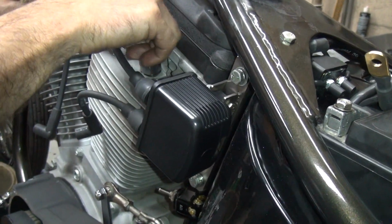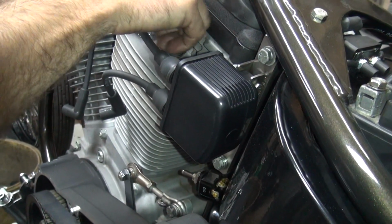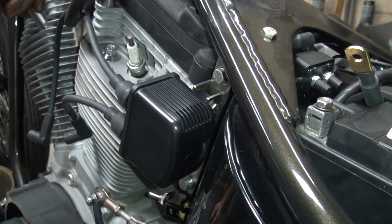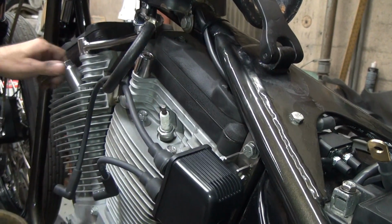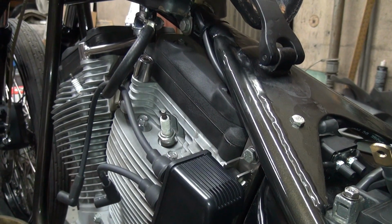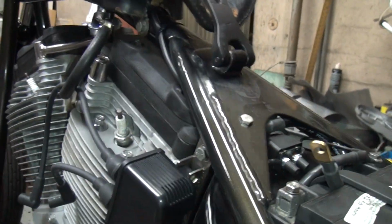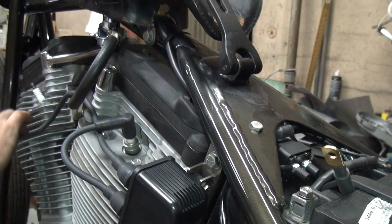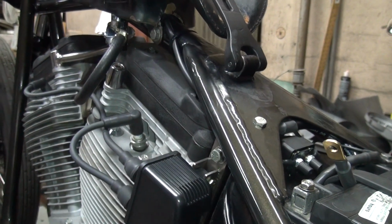How long is that belt going to last? Would a belt last, being that narrow? I've seen them come out like that before. They're worn that far, yeah. Don't know how long they've been that way, but obviously it took a while to get them going that far. So in open, dry primaries like this, the belt trails back and forth, and it's going to just keep wearing and wearing. Well, it's supposed to track to the outside, but it goes wherever hell it wants to go. Now, obviously, with this thing wobbling like this, we don't know where it's going to go, but it'll do what it wants to.